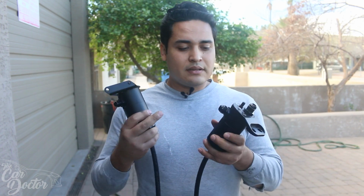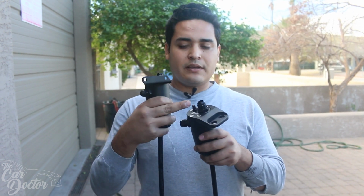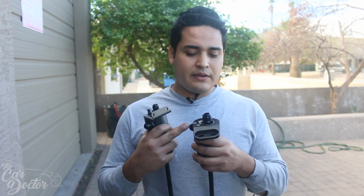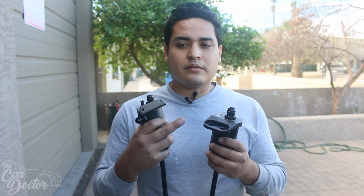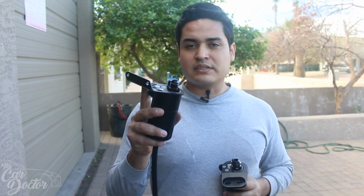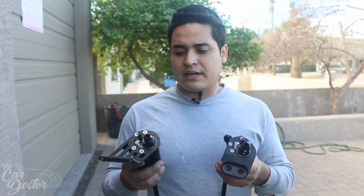And these come unassembled. I assembled them real quick. We just put dash 10 fittings on one, dash 8 fittings on the other. And the one that you put the dash 10 fittings on uses this weird, different type of bracket that's gonna be mounting to the motor mount. And then this one, this is actually mounted to the motor mount that we just installed. And then this one's gonna be mounting to the ECU bracket. That's why this one has dash 8. That's just how they did it.